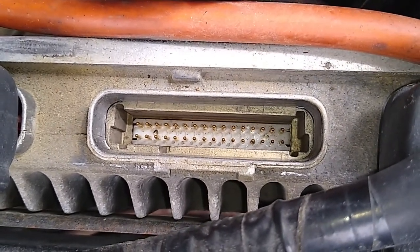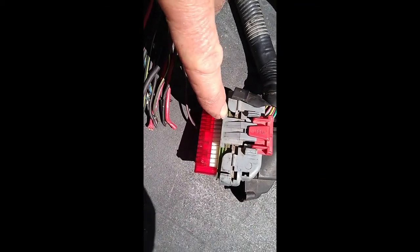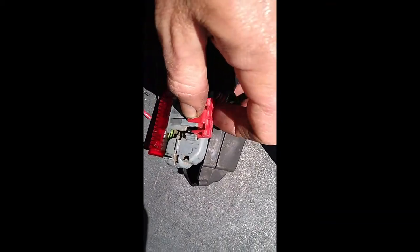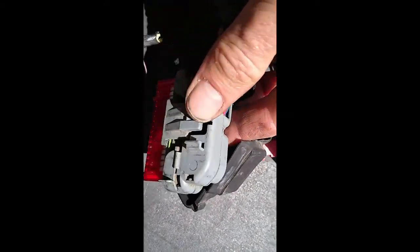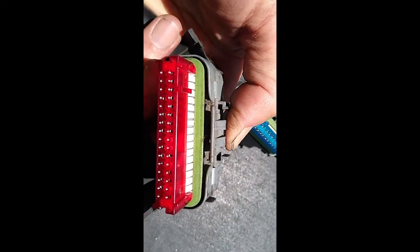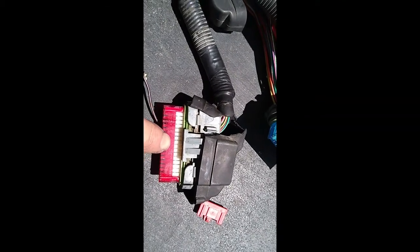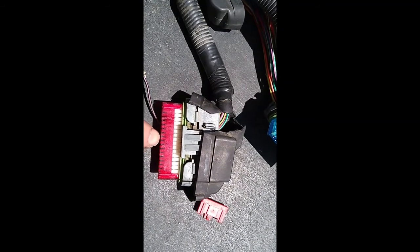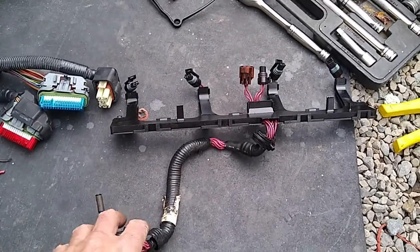I've got one down on the ground here which does have some oil that has leaked back through it and I'll show you that now. Quick note: when you go to pull this connector out of your computer, there's a red safety clip in there that stops the release mechanism from operating. You have to pull that out first, then you can squeeze on it and it lifts the release pin or release bracket out on the side, allowing you to lift this out. Be careful - pull it out nice and straight and even, otherwise you'll bend and stretch the pins and end up with intermittent connection problems.